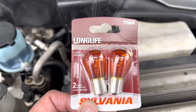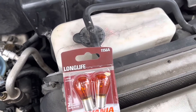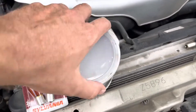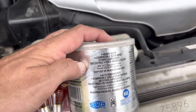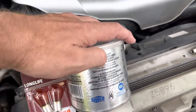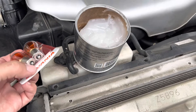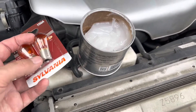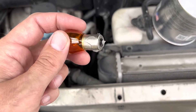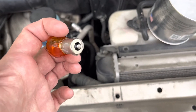Note that these little nubbins are the same and equal on both sides — that's important. You'll find different bulbs with different types, but as long as you're getting 1156 you're good to go. Now we're going to grease them up. You don't have to use any grease, but you can buy a little pack at the store. I already have Super Lube — it's a silicone lubricant, but importantly it is dielectric, meaning it's good for electrical connections. It keeps water and other junk out and keeps the part in good shape. We'll put a little grease on the contacts — a little on the outside and a little on the center contact, but not smeared all over everything.